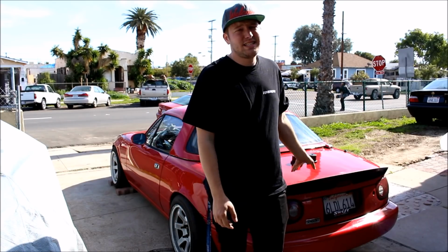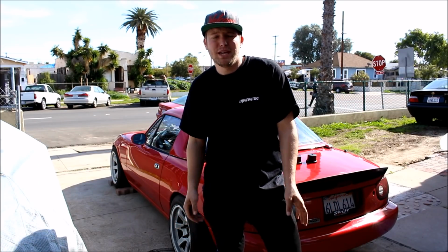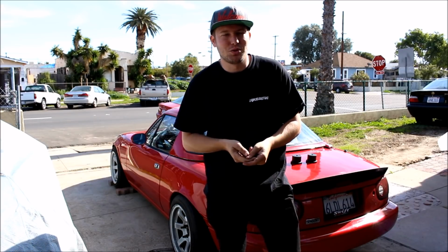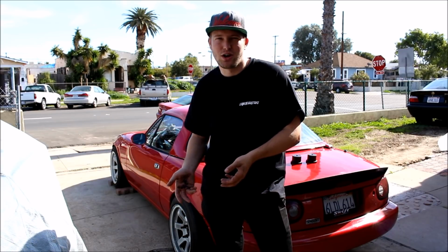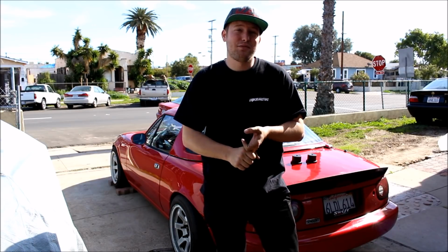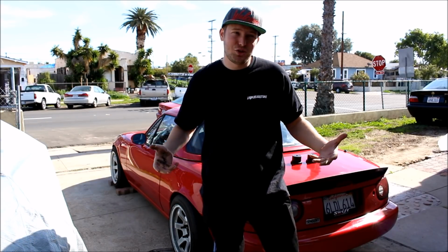So my car is a 1992 and it has the differential from a 2002 Miata. And I'm sure your Torsen swap questions are brewing right now, so I'll go ahead and answer the most common question I get. What do I need to swap a 1.8 liter differential into my 1.6 car? All you need is the differential itself, the axles, the drive shaft, and the drive shaft bolts. Other than that, it just fits, it just bolts right up.